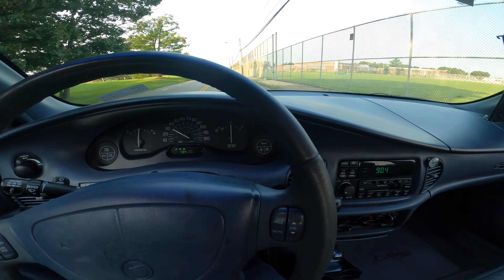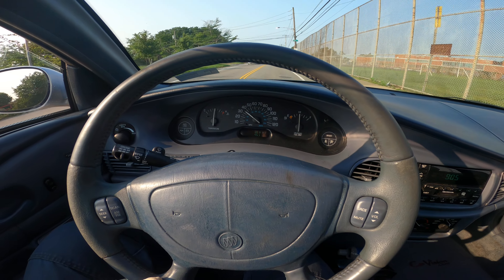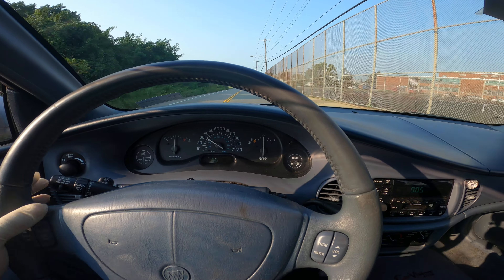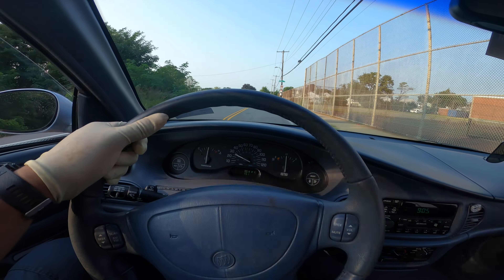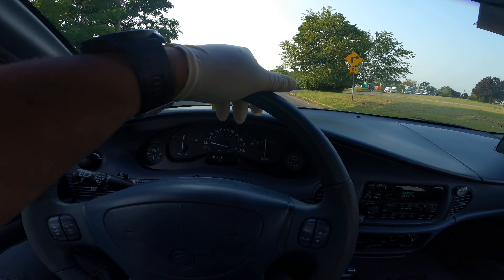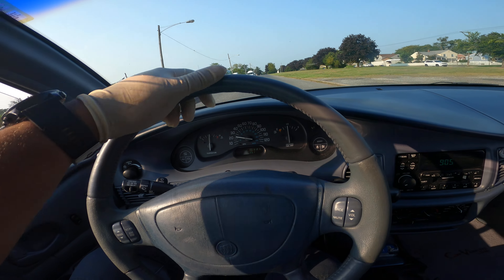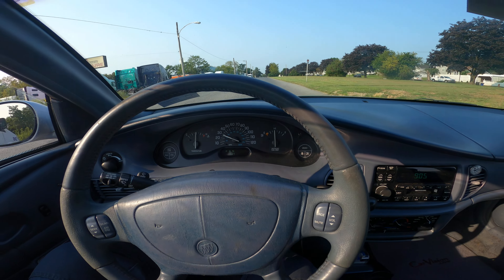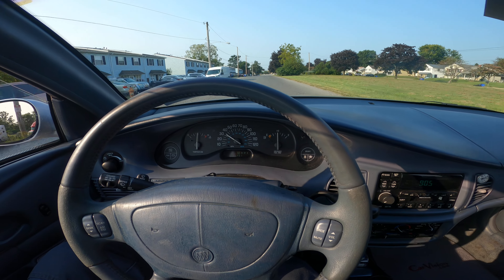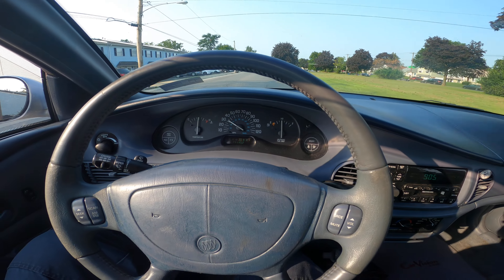You can actually use your scanner to read the speed as you're going while you're driving — I'm not that good at driving and showing data at the same time though. If you guys have any issues like your speedometer not working, or your car is just revving and not switching gears like this car was, it may be a speed sensor.